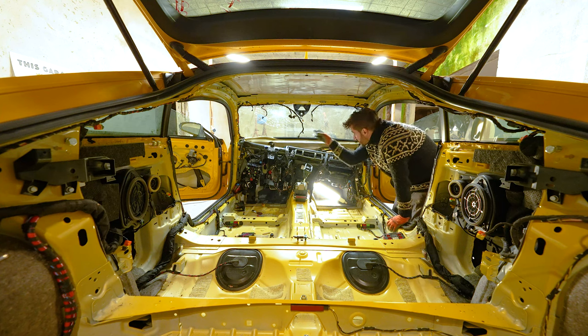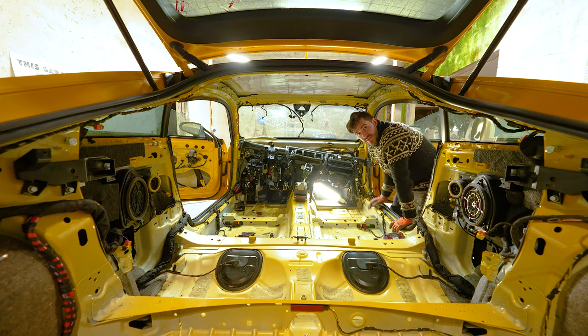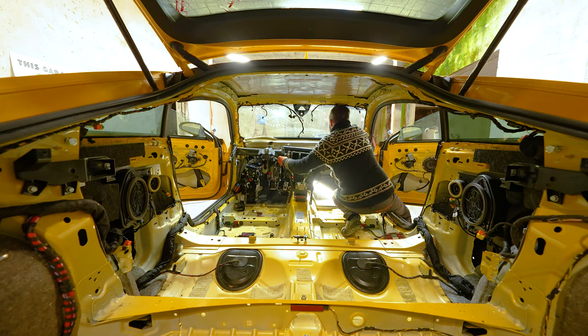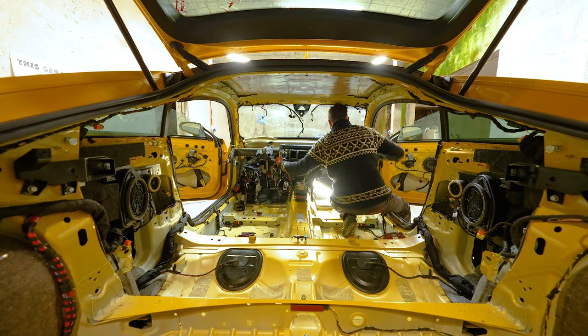And then there is one screw where you have to remove the windshield wiper motor first. Obviously, I'm getting tired. And then you can remove the screw from the outer side in order to release the frame. And the frame goes out together with the air conditioning unit. And I think that if I'm not mistaken, I have managed to undo every single clip. I have no idea just how heavy this is going to be.